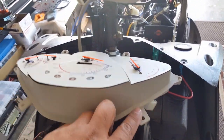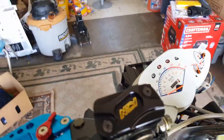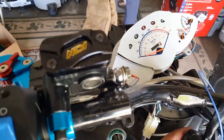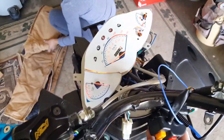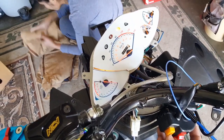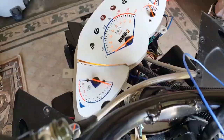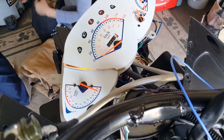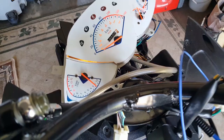Let's take out the keys and put the key back in. We got it turned on now — we're going to see if the RPM will show on a fresh start. Hold down the brake lever and push the start button. See that? It's climbing — going between 1,500 and 2,000 RPM. There's 3,000. It's amazing, isn't it? So it's still working. We kind of fixed our RPM issue. So if you have this kind of issue, maybe you just have to disconnect this wire and reconnect it while it's on. Maybe what it does is send a signal pulse saying, 'Wake up, we just got started.'